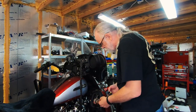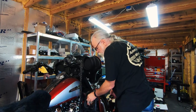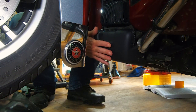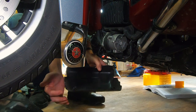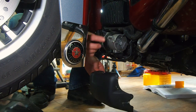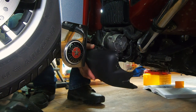We're going to leave the cap off since we'll need it off again when we drain the coolant. We're also going to open the cover to the water pump on the twin cooled system — this is normally where Harley puts the oil cooler on touring models, but on twin cooled models it's a water pump instead. It's held in by two buttons that go into rubber grommets on the bottom, and two clips up top.